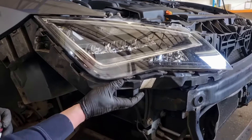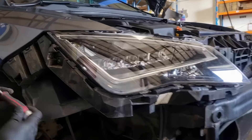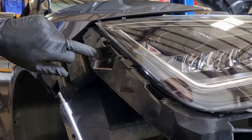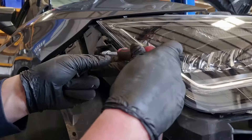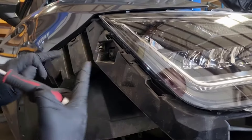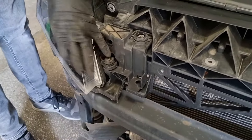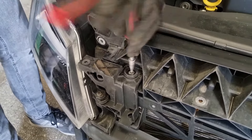This little bracket here can actually stay with the headlamp and come with it — you can remove it afterwards if you want. We need to remove the bracket where it attaches to the car, so there's one here — it's this smaller T25, not this T30 here, you don't need to undo that, just the T25 there. That one holds the headlight bracket to the bumper bracket on the wing. And on the inside there's another one — this one holds the headlamp to the bracket, just where the bracket bolts to the vehicle — that's the T30 there.